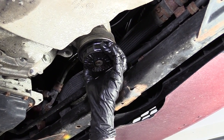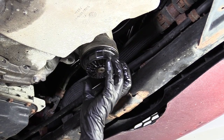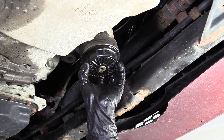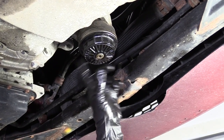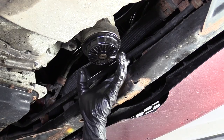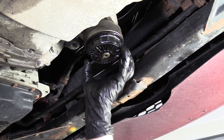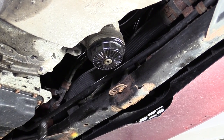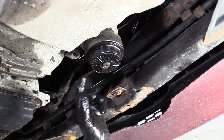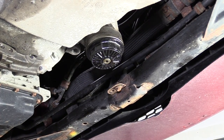For some reason this particular design — my filter covers don't fit on this housing and it seems like it's kind of worn out. If it was a newer Mazda, the oil filter wrench I have probably would fit, but I cannot grab it. So it also seems like this car could use a new oil filter housing cover, which you can buy at 1aauto.com.